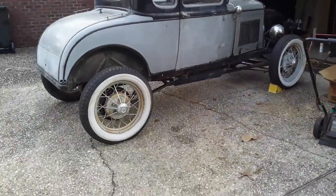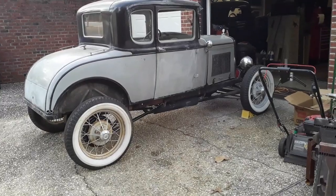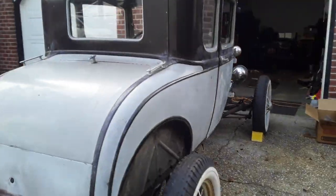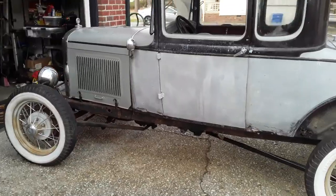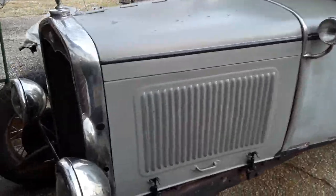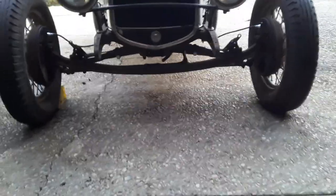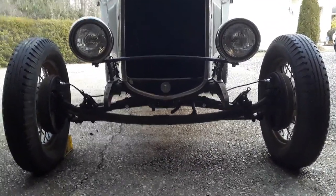She'll be driving again soon — the driveshaft is about the only thing standing in the way, but I'm going to do a bunch of things while I'm waiting on that. If you've got comments, questions, or concerns, leave them below. I'm pretty happy with how she's coming along — real happy how that front spring cleaned up, still got good flex, it's a whole lot lower now, and I don't have to worry about the shackles failing on me anymore. Alright, take care, see you guys later.